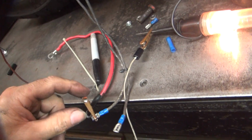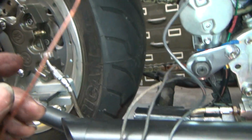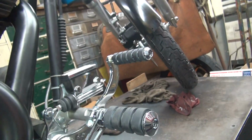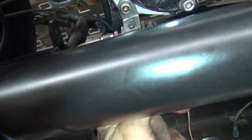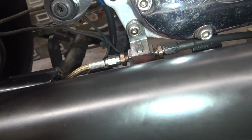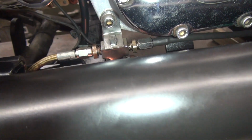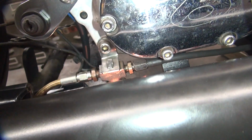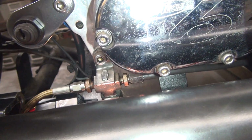Okay, so what are we doing here? Where's our jumpers at? Okay, this one's powering up our wire to the switch. We come out of the switch to the other one, and that should be off right now until we hit that thing right there. And it is on, which is not what it's supposed to be. And we still have a little bit of a leak under here for some reason. That's a brake switch that's giving us issues.